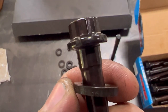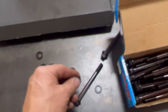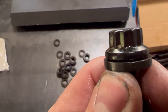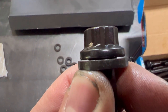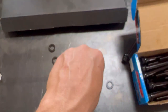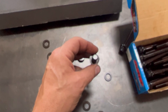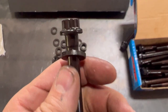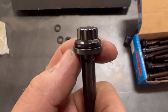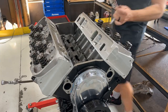And if you put the square edge of the washer up against it, it will hit that radius and make a little weak spot in the bolt. As a matter of fact, you can see that. See that little bit of air gap there? That's all the way up, but it'll tighten up, it'll torque, it'll crush it down, but it will have a tendency to try to crack the head off there. So that's just a little FYI, just a simple tech tip. If you're not paying attention, you might not even know it, or you get washers and people just throw the things on there. That's what they're made for, to have that chamfer always go up.